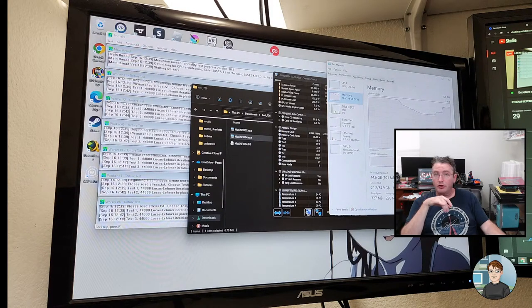If it does work with the hard drive with Windows 8, you could re-image the hard drive to the solid-state drive, run it in Windows 8 and see if the problem goes away, and then upgrade it to Windows 10. If the problem happens again, then you've got your answer. It's something with Windows 10 and that computer not playing right with each other.